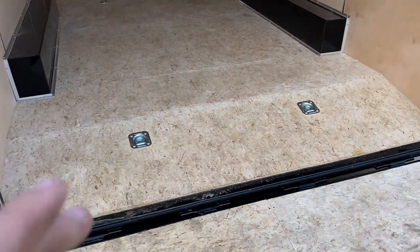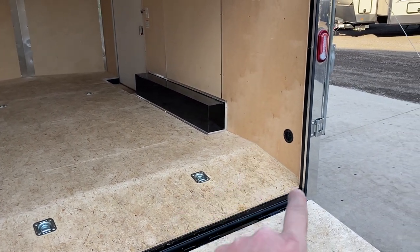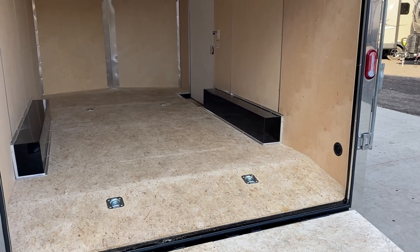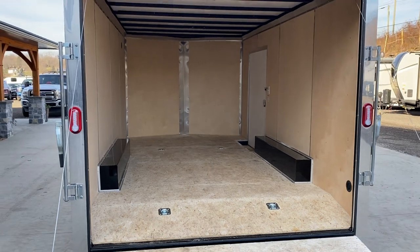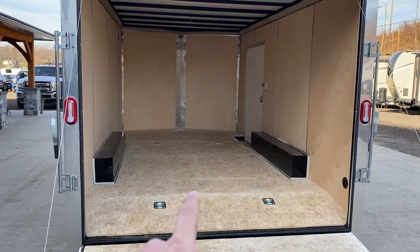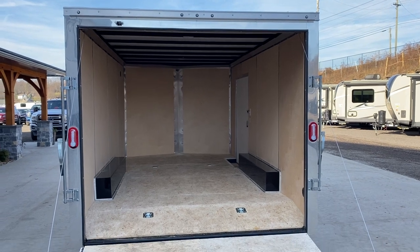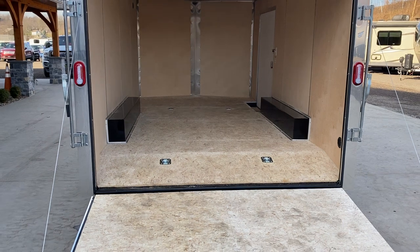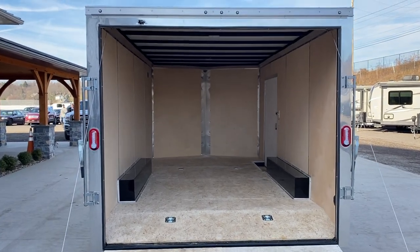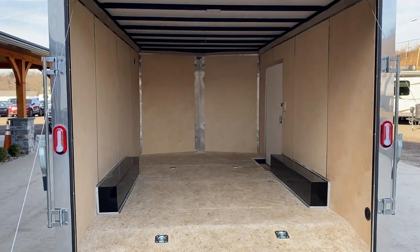A couple of things that make a car hauler a car hauler: four D-rings, and one of the bigger differences — a car hauler is going to have a no-show exterior beaver tail. This being a 16 foot, it's got a two foot dovetail; as you go to 18 foot and longer, it's going to be a four foot dovetail. That's a key point for most folks because it picks up about four more inches of clearance — great for UTV guys. On a 6'6" inside height car hauler, you normally lose about six inches on your rear header, which on a flat floor nets you roughly six feet. With the beaver tail at the back, you pick up about four inches. Most Shore Track standard 6'6" height car haulers with a beaver tail will net you about six foot three and three quarters through the door headroom opening — enough for most average UTVs. Folks with taller rubber might need a plus-six-inch height adjustment.